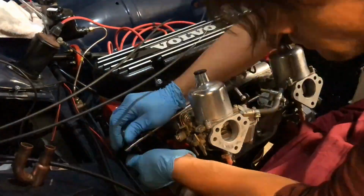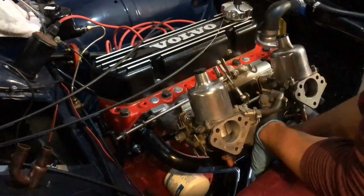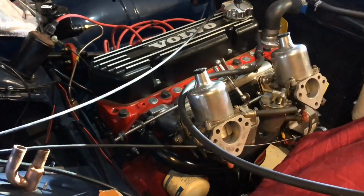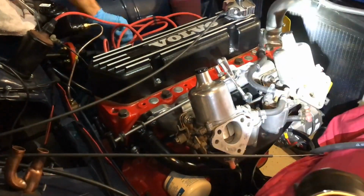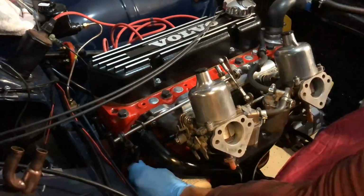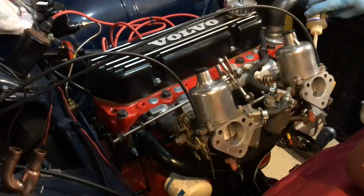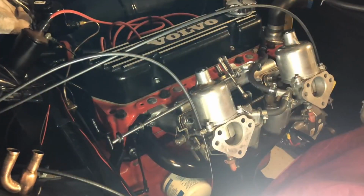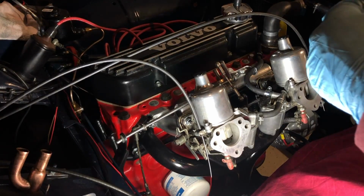The flange on the headers, okay, so yeah, it's aftermarket. There's no substitute for an original, yada yada, but they're designed for this style, yet when I put the washers on, they don't make contact with the intake manifold, they only make contact with the exhaust. The exhaust manifold needs shims to meet the distance on the intake. Now, that kind of sucks, because that means I gotta go cut some washers now and do the same old, same old. 3 hour time lapse that was.